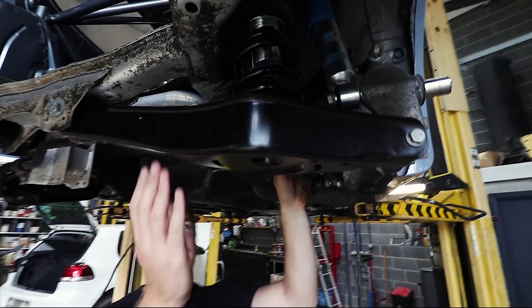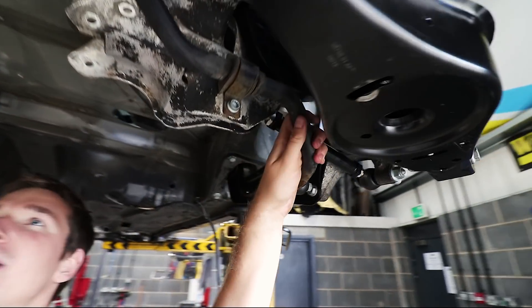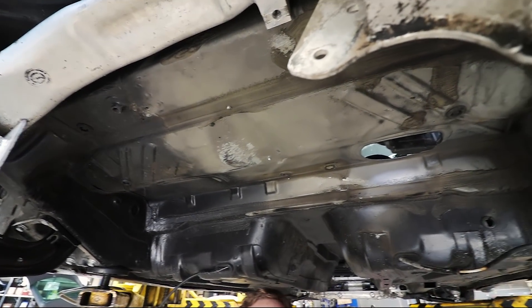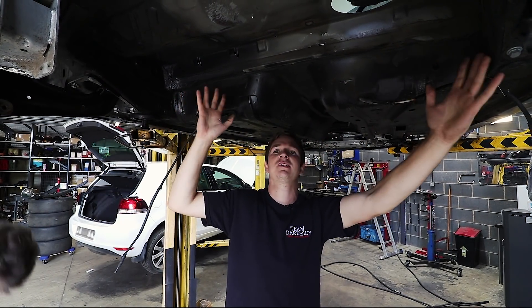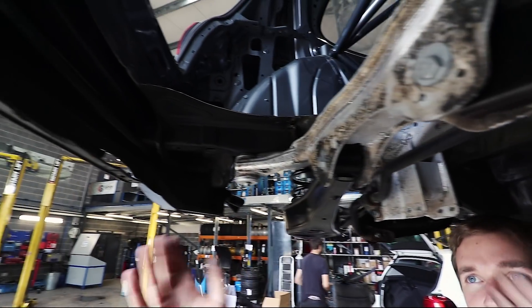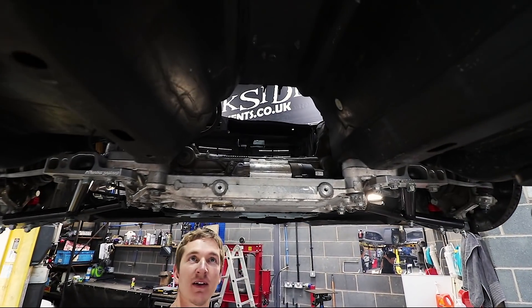Arms are all on, bushes are all in. These are the only ones with camber adjustment - it's really only going to do camber as I said. Anti-roll bar with adjustable drop links is all bolted in. Spare wheel well's gone. We're potentially going to put a Quattro fuel tank on for better weight distribution - with a normal tank you end up with a bit more weight on one side, which isn't ideal with the driver on the right. A Quattro tank means we can run a straight exhaust with no bends. Steering rack is coming off the donor car - we'll leave that on until we've changed the subframe.